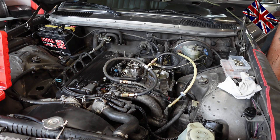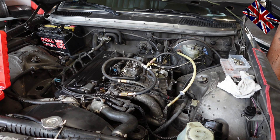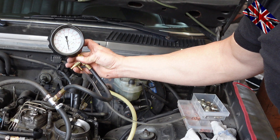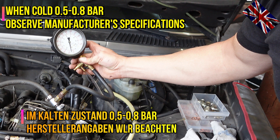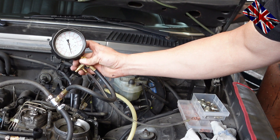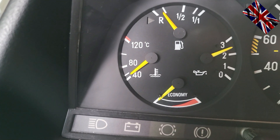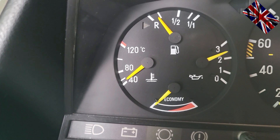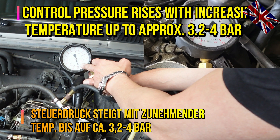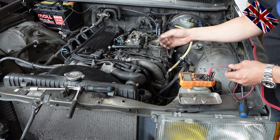We start with parameters. Engine cold — way below 35 degrees Celsius. Pressure should be very low and should rise with increasing engine temperature. I'll fire her up. We got some 0.5 bar, equivalent to 7 psi, which is the minimum. With increasing temperature of the engine the needle is moving. As we see, the engine is getting warmer bit by bit. Pressure of fuel is rising to 1.5 bar, equivalent to 22 psi, and still rising. Check is almost complete — WUR is in good working order.